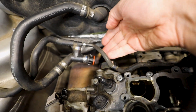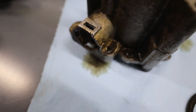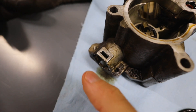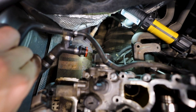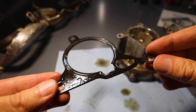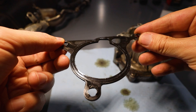It'll be a two-hand job to do this, but it's actually easier to show you with this port already disconnected. Note the two tabs on the top and bottom of the vacuum port right here — you'll be able to depress those two tabs through these little windows. There's one on the very front and one at the back of the housing. Take a flat headed screwdriver, pop them in there and basically just pry against the housing itself and you'll find that the port just kind of pops right out. With the vacuum pump out and things cleared out of the way of the engine bay, I've had a second to do some inspecting and I think I'm ready to make a diagnosis for this leak.